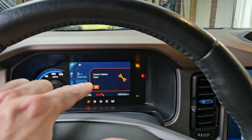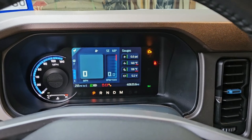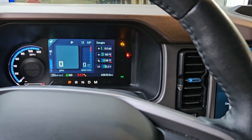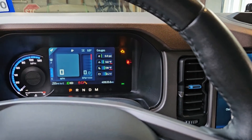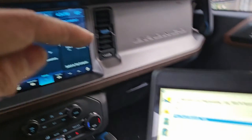After the flash, you're going to get some error messages — 'Check 4x4' and 'Service Vehicle Soon.' This is something that comes up on newer vehicles. In the past it would just automatically accept whatever circumference you put in, but these don't do that anymore, so you have to go back in and clear the codes.